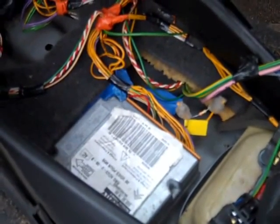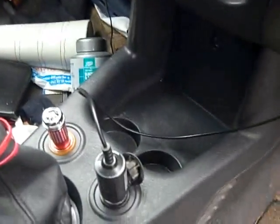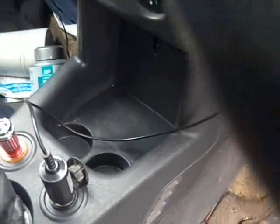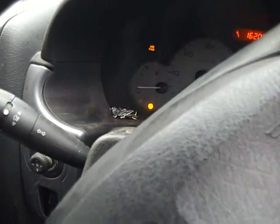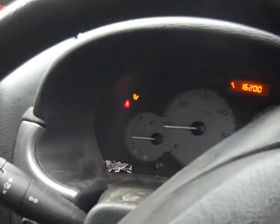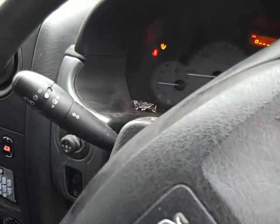That's it — the thing will pass the MOT and the airbag light will go out after three seconds. One other thing to note: do not work out the resistance of the airbag by putting a multimeter over it — it might explode. Don't do it; look it up. It's 1.3 ohms. Airbag light on... engine on... airbag light off. I'll turn the passenger's side airbag off anyway with the key switch here because I really like airbags. There we go — save yourself about £500.